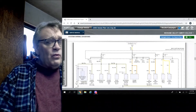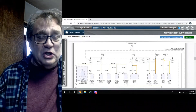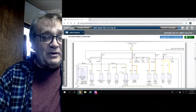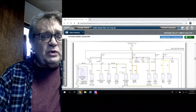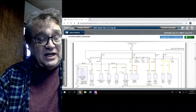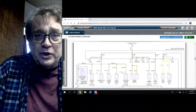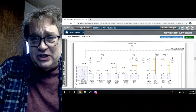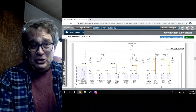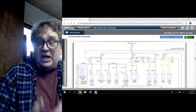So what would be the next step? The next step would be to figure out which one of these loads is actually blowing the fuse. It could be one of these loads has gone out of spec, shorted out, or something happened. Or even worse and more expensive, we could have a harness issue where one of these wires has rubbed through or some idiot has gotten in there — that's real common — and now it is shorted to ground. It has a short, which means for some reason it has lowered the resistance of the circuit. Lower resistance means higher amperage. So the fuse blew because amperage went over its limit.